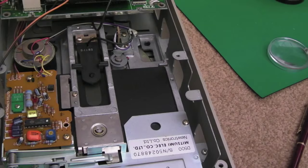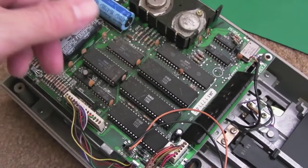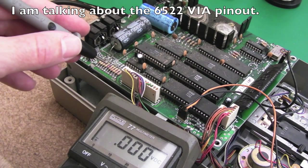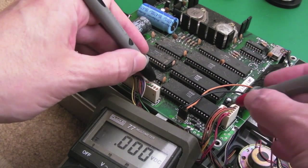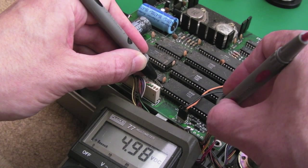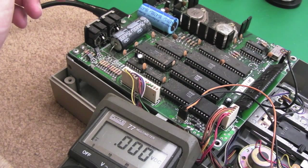I'm going to need to connect this up to a C64, but first I'll measure the voltage coming out of these regulators. Pin one is ground, pin 20 is VCC. Let's just measure — nice clean 4.98 volts. Well, I say clean — I need to get the scope before I know whether that's truly clean, but 4.98 volts is okay.